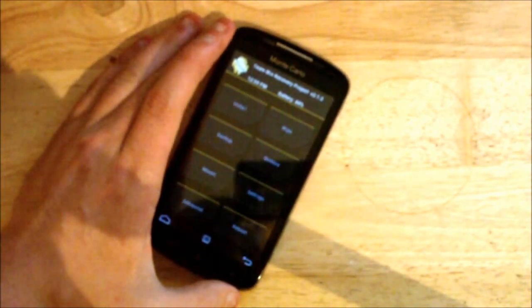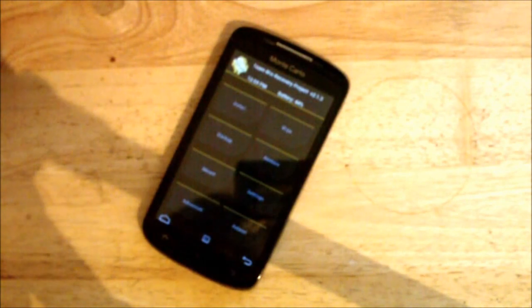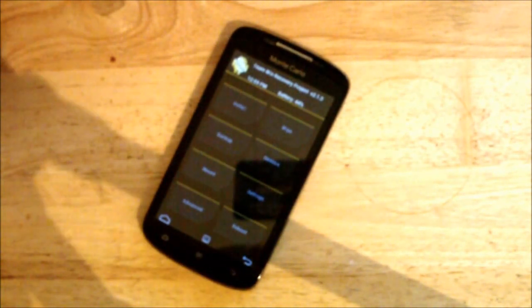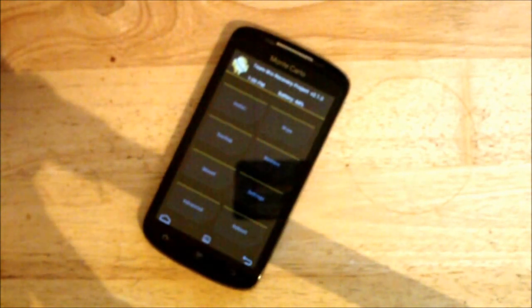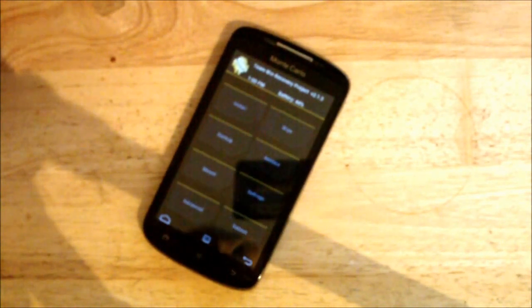This is actually my dad's phone — he has the same as me — and he let me do this. So this is the Team Win Recovery Project. I'll put a link in the description below to go to the forums where you can download this. There are a couple of ways to download it. The easiest one is simply a Clockwork Mod flash file — a little .zip. You flash it into Clockwork Mod, install from SD and click the touch recovery. There's another one where you do it through command line like ADB push — that is a .img. And there's also a .bat install script for Windows.